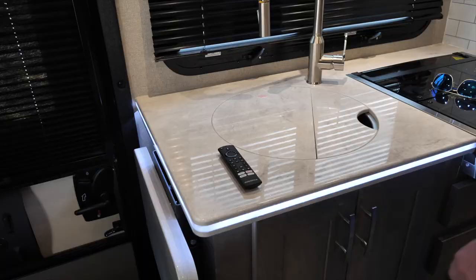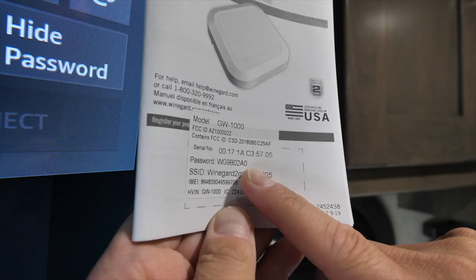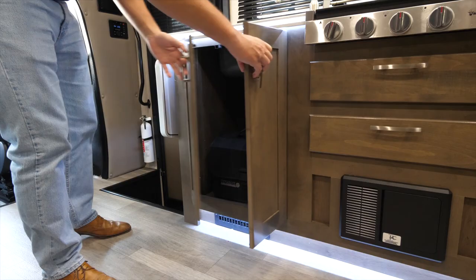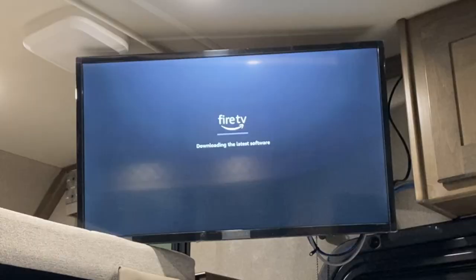Next, turn on your Smart TV. If you have not previously set up your TV, a series of available Wi-Fi networks will appear. Click on the network you wish to connect to and type in the password if applicable. If you are connecting to your Weingard Air 360 Plus or Connect 2.0, please locate the owner's manual found in your Dynamax black bag and follow those instructions on how to properly connect.